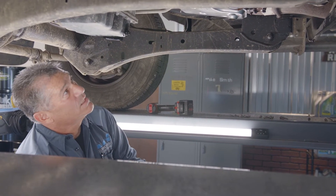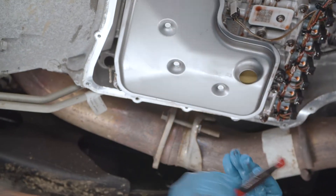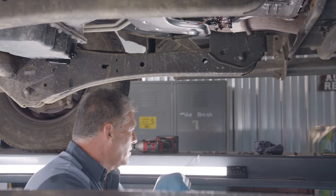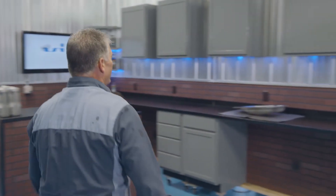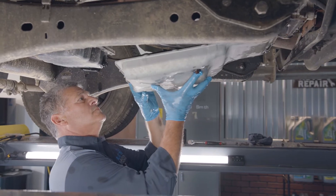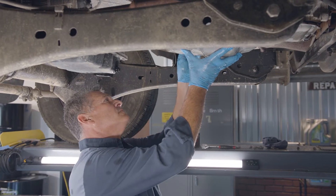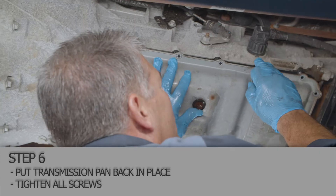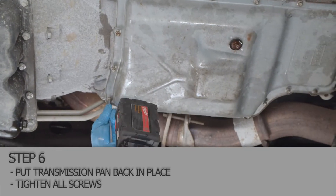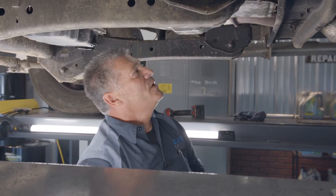I'm going to go get the pan and get it ready to go up underneath there. I always take a ratchet and go over these bolts that I just used on my little zip gun there. Make sure that everything's tight enough because you can't always rely on those battery-powered units tightening things down like they should. Get the pan gasket back up into place. We've got that all tightened up down here.